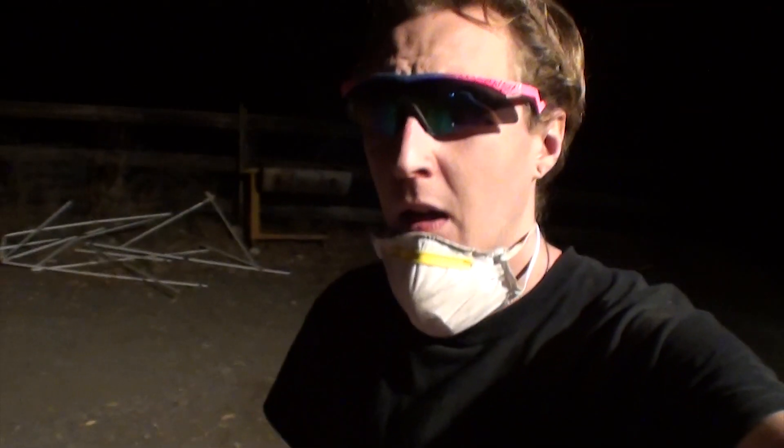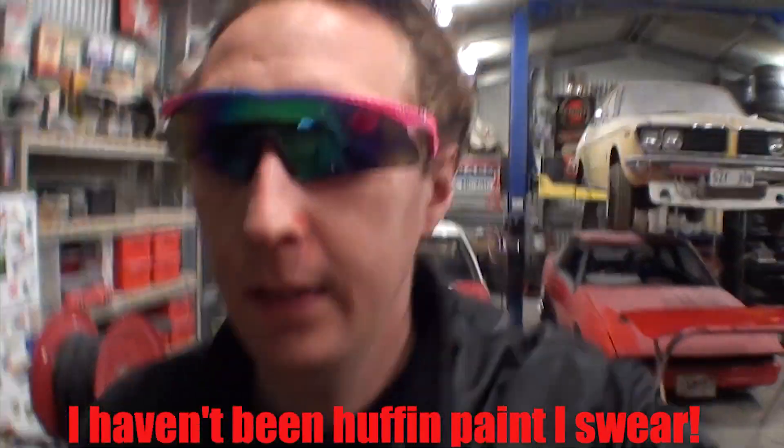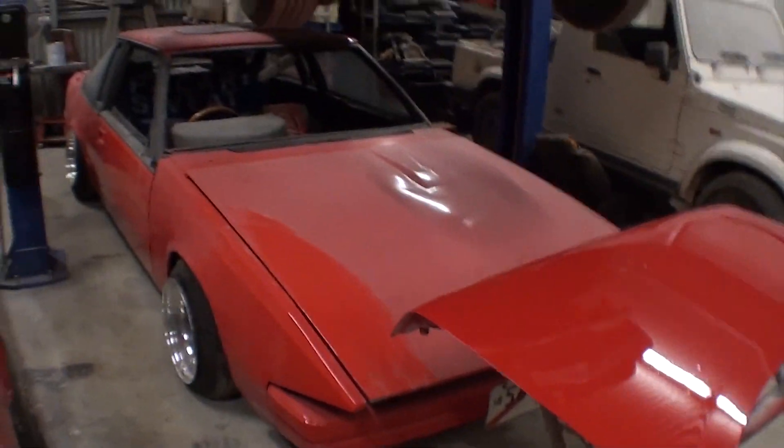Just getting ready to do the rear bar now. I just gave the front and rear bars their first coats — not bad, shiny. We're trying to get that boot to dry so we can try to get the moth guts out of it. That's just the risk you take when you paint outside and not in a proper paint booth. I did spot that I got a couple of runs in here — we're gonna have to try to wet sand those out. The indicator cover covers it so I think I'm pretty safe.